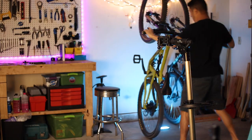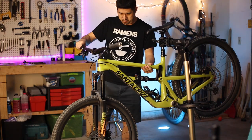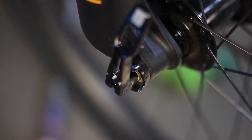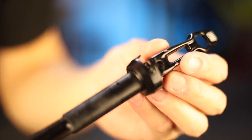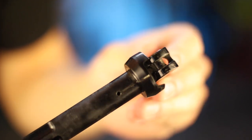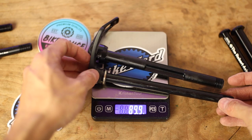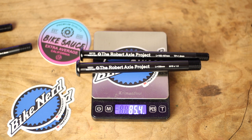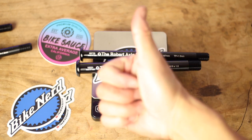Now what actually motivated me to replace my through axles was that I didn't like the stock maxel through axle that came on my Santa Cruz Hightower. The pseudo quick release design is, in my opinion, poorly executed and somewhat obsolete. These little tabs that bear the entire tightening or loosening torque are so easy to bend, and once they are bent, it makes removing your wheel a bigger challenge than necessary. They're also kind of bulky and unnecessary, and like many of you, I carry a multi-tool with the right size hex wrench on basically every ride. The lever handle is just excess metal that can get snagged on brush or scrape against rocks as you're riding. In my opinion, a plain hex head through axle is the way to go on just about all bikes, and it just looks way cleaner too.